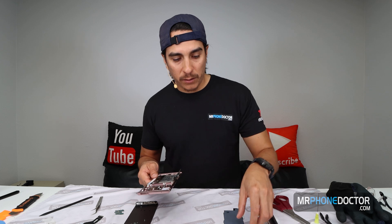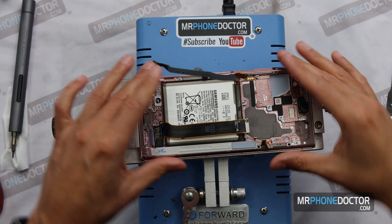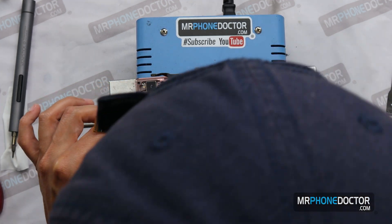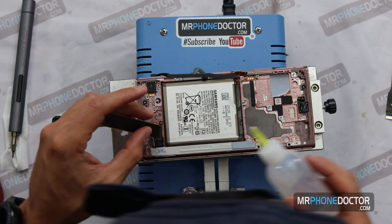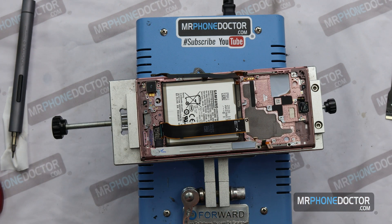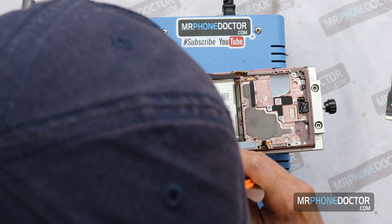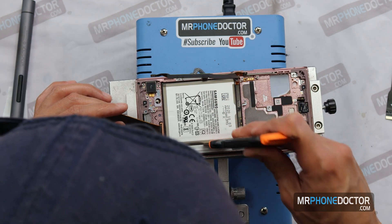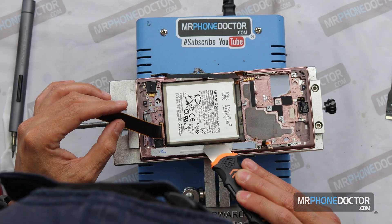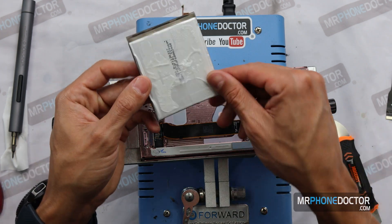The final step is to remove the battery. I'm going to put this back onto my heating plate and dislodge the battery — tightening it down so it doesn't wiggle while I'm prying. I'm going to add a little bit of 99 ISO, just a thin little bead right here, to help soften the adhesive. Then we use our pry tool — get right in between the frame and the battery, give it a little pry, just a couple of small prys, and you'll see it just pops right out. Doesn't require a lot of force — just nice and gentle. Battery is removed.